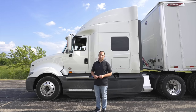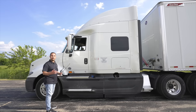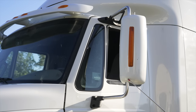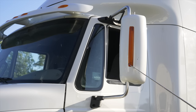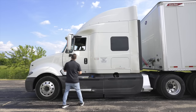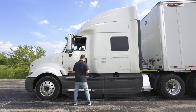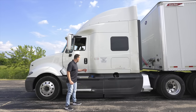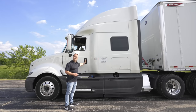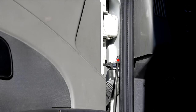Let's start off with our door area. First I'm going to check my driver door — make sure it's not broken, not cracked, on secure. My mirror bracket and mirror mount are not broken, not cracked, on secure. The marker light on the mirror is not broken, not cracked, on secure, proper color, and acts as a running light. My lenses on my mirror are not broken, not cracked, on secure, clean and clear. My door handle is not broken, not cracked, on secure, it opens and closes freely. I'm going to open the door to inspect my door hinges — not broken, not cracked, on secure.